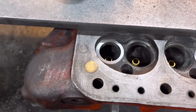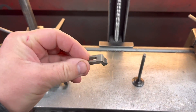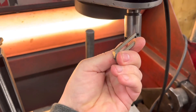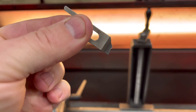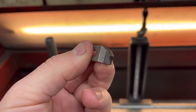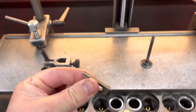We've topped off all the seat inserts. Now we're going to set up the 45-degree cutter — or the three-face cutter — which is this little beauty. That goes in the tool holder like this, and as you can see you've got the three angles there, the centre one being the 45-degree by one-and-a-half mil wide, and that is what puts the seat on the new insert.